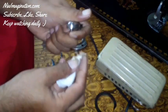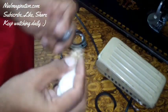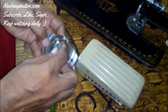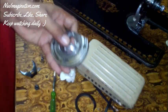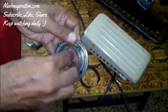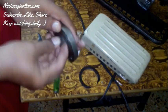Clean the shuttle thoroughly. After that you are going to clean this disc — there is one disc which is out and one disc with the sewing machine, and you are going to clean both with the napkin. Fold the napkin and try to reach all edges of the disc and shuttle. Then insert the disc into the shuttle and pour some oil, circulating it inside the shuttle so that it will work correctly.